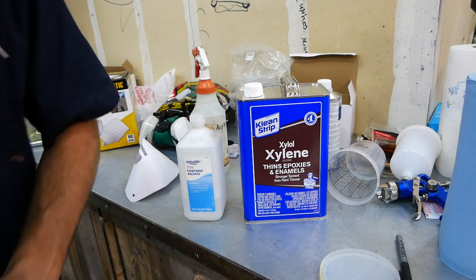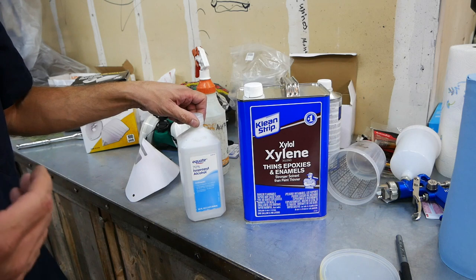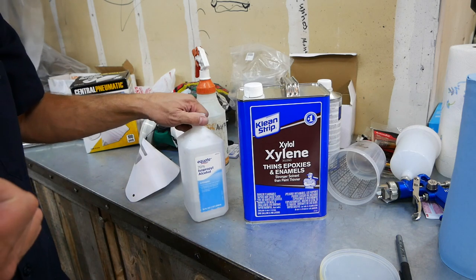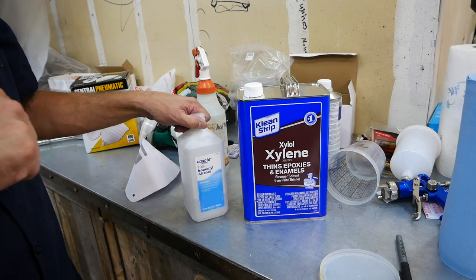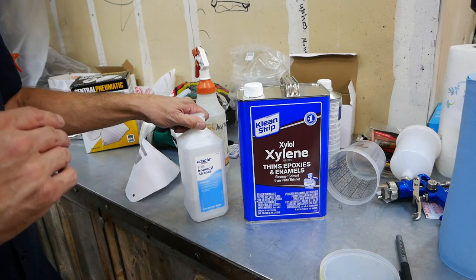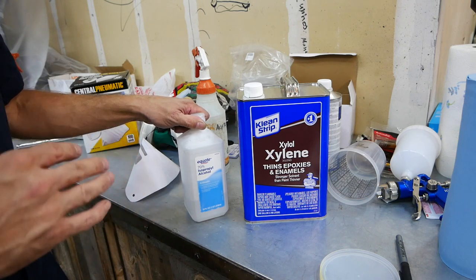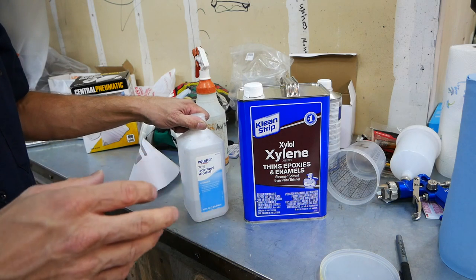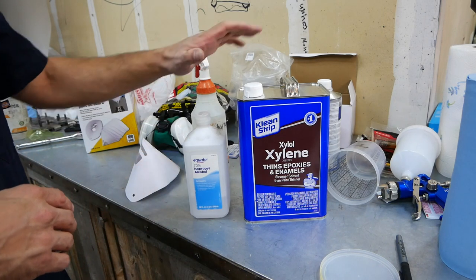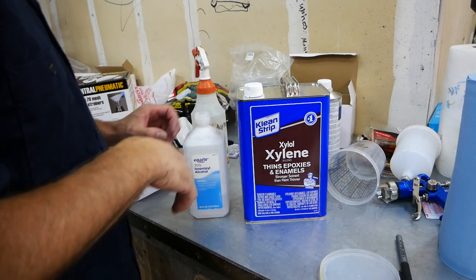Whatever you do, do not use oil-based sticker removers like Goo Gone. We did do a couple of them with Goo Gone. Goo Gone works really well and pulled the sticker off. But then when I went to clean the body, I noticed that all of the water and the TSP that I was using to clean it would shed off of that area. So obviously it put a layer of oil on there. Hit it with some xylene and isopropyl alcohol, and like that, it was clean again.